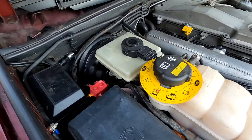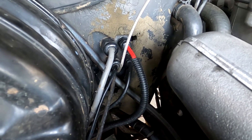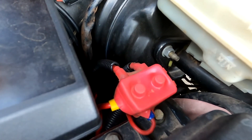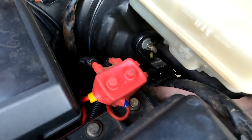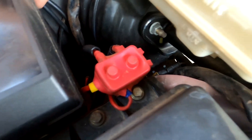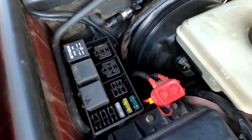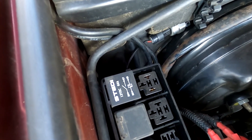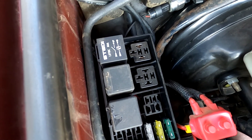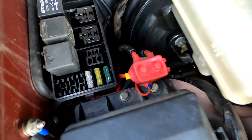Something else while I'm in here — you can see I've got where the clutch would go. I've got all these grommets going through the firewall for power. I've got a main circuit breaker — a self-resetting one. The jury's out on whether they're any good or not, but I haven't had a problem. That feeds the car into this box here where I've got my relays for my lights and fuses. I've got heaps of room for extra things, but the main idea was to neaten it all up rather than having it as a jumbled mess.